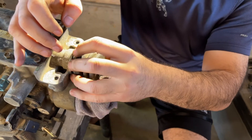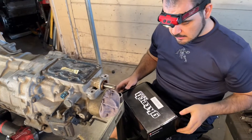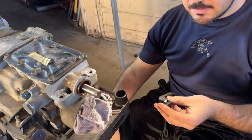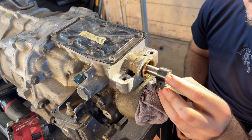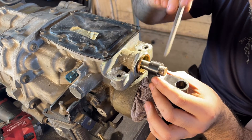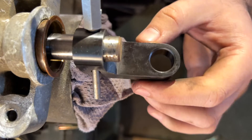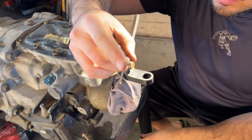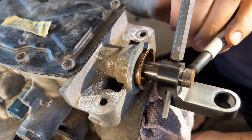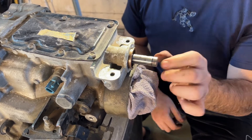Now we take this joint out — this is not something we're gonna need — and take this boot out. Now that we have the shaft exposed, we're using the GK Tech shifter location kit. We grab this small bracket and slide it in, lining it up to where the roll pin was. With the same punch we used, we slide it in where the roll pin goes so it's held in place, then take a marker and draw a circle around it to mark where to cut. Now we take off the punch and bracket — this piece here we're going to have to cut off. Let's start cutting.